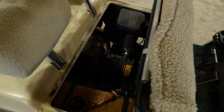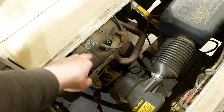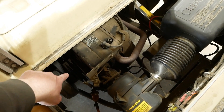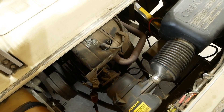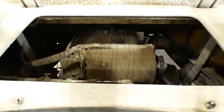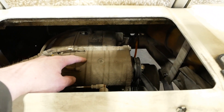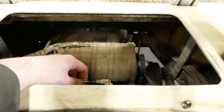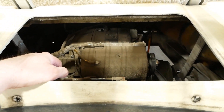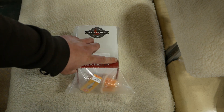Under the seat is the business end of it. I know very little about golf carts — I'm sure this video will reinforce that. There's the engine; I think it might be a Club Car engine, they might have made their own. And there's the drive system — it's just a variable belt torque converter like a snowmobile. That's the starter and I believe also the generator belt drive. It does have a forward/reverse gearbox shifted by this little cable, and there's the rest of that drive belt. Down here there must be some kind of gearbox that actually connects it to the wheels. Here's the tune-up kit — not much to it: two fuel filters, a spark plug, and an air filter.